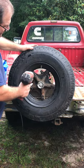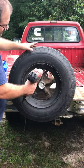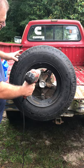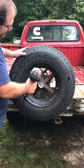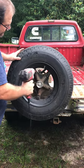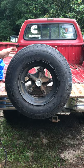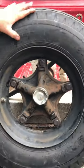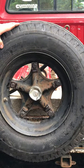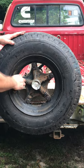Spinning good. Now I'm going to go all the way around evenly. What you're actually wanting to do is get these wedges to actually dig into the rim — that's very important. If not, it'll spin and it'll come off. That's why it's so important to have the threads clean. Some people just try to run the bolt in and it stops and they say, 'Oh, it's tight.' Well, that's not correct — these wedges have to be tight.